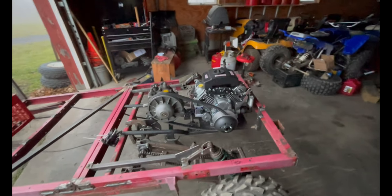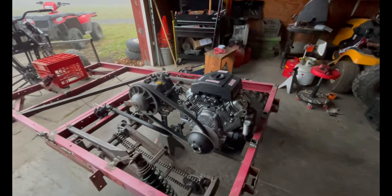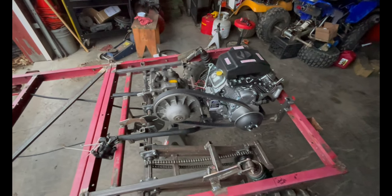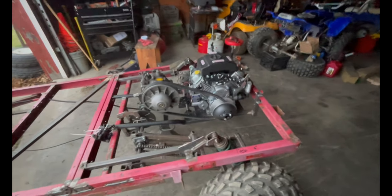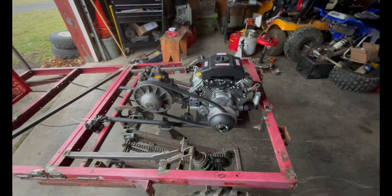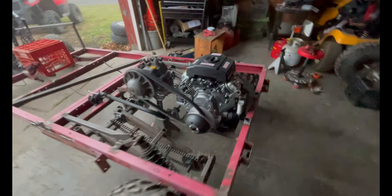This is a part that I kind of want to document a lot of, because it's an interesting part. So right now, the engine's mounted, did that last time. We've got the transmission semi in place. We've got a belt that almost fits. We're probably gonna drop the length a little bit so that we don't max out the rear of the engine's travel for tension. So we'll probably drop that size down a little bit.